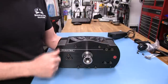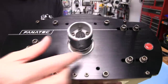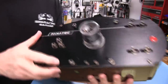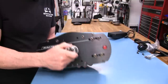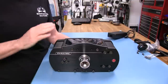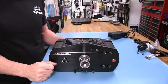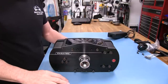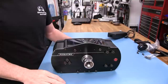We have ribbed belts, but we'll see more of that once we get inside. The cool thing is they're actually using sealed bearings — a big bearing in there for the shaft. There are sealed bearings throughout the assembly, so it's really heavy-duty. They're considerably bigger than what you'd find in something like a Logitech. And they actually use grooved serpentine belts instead of cogged or toothed belts on their pulleys. We'll talk more about that when we actually get inside.